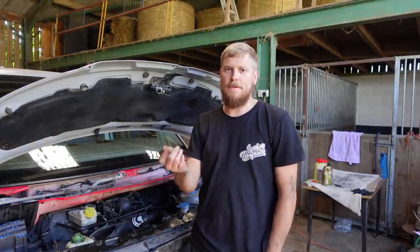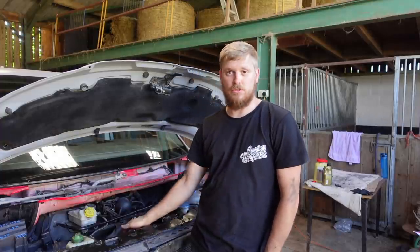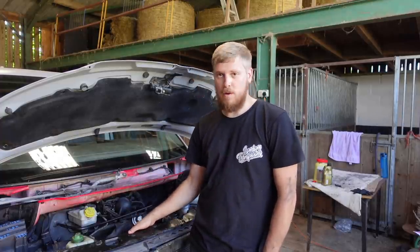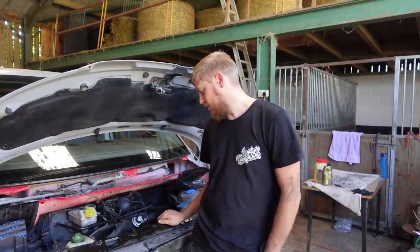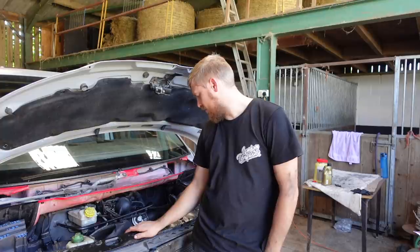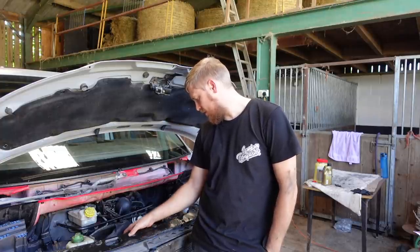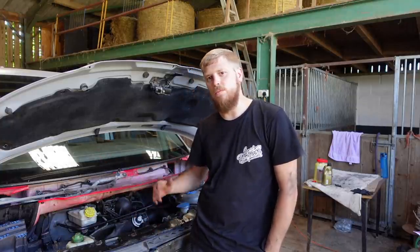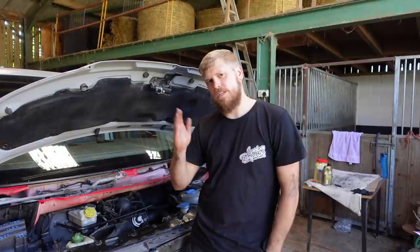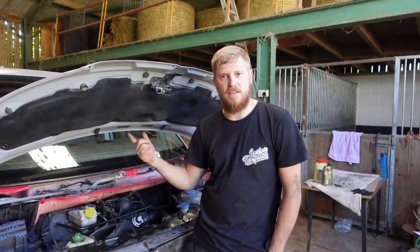If you don't know who I'm talking about, go back and watch the last episode of having the head all sorted out. Super helpful company, I would definitely recommend them. I've obviously got it all back together and everything, and it runs, it does what it's supposed to do. The heat is now blowing hot, which they weren't for a bit, but I sat at 2,500 revs for a minute, and then they started blowing warm, so there was obviously a bit of an airlock there.